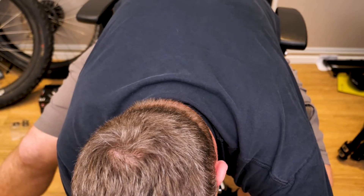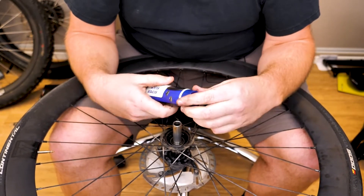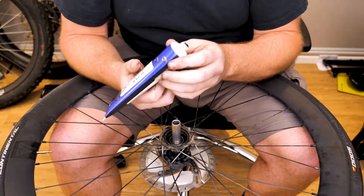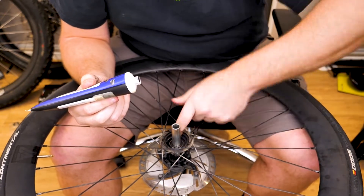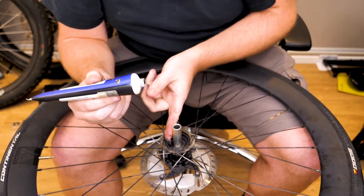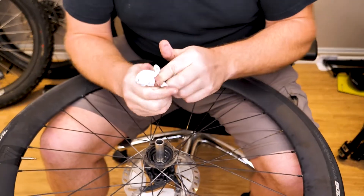While you're in here, you should always clean your freehub body inside — make sure you get all the extra dirt out. The stuff I've been using is a super slick grease from Rock-N-Roll Lubes. It makes the freehub quite quiet and quite slippery, which are two very good qualities. And being grease, it should stay in place a little bit better. Get a gob of it on your finger and smear it around the inside. You don't want to get too much in there though, as it'll actually clog up the works.